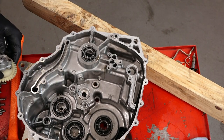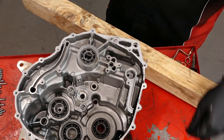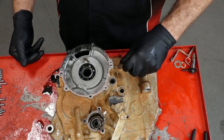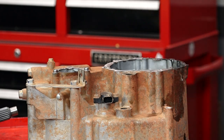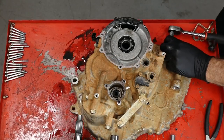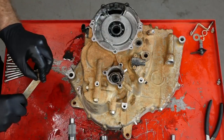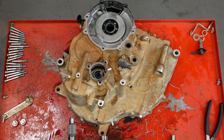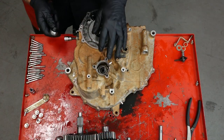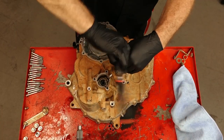Let's see if we can wiggle these dowels out without damaging them. Then we can lay it face down after we get the dowels out and remove all the sensors and brackets on the other side. I still don't know why these bolts are there — my guess is they had to drill through and then this is their way of sealing up the case, plugging it, because each one of these has a copper washer on it. It's just not holding anything, it's just plugging it up. They were probably having to drill these different passageways.